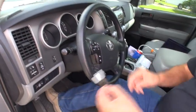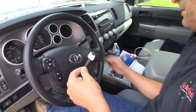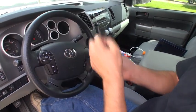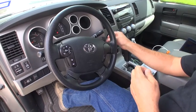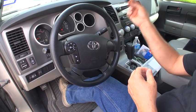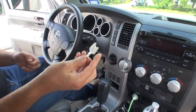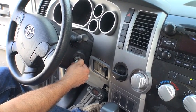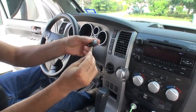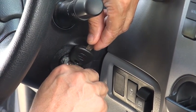The program is done — disconnect the cable and put it away. Now we check to make sure the key we programmed actually works. To do so, I'm going to use a key without the chip — I removed the immobilizer from it. I put that key in the ignition, then hold the new programmed key right next to it. Because if it's close to the ignition, the magnetic field will pick up the code out of the new key and the truck will come on.